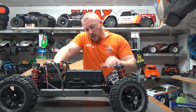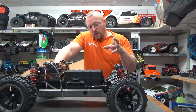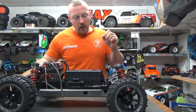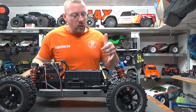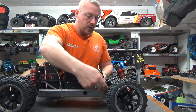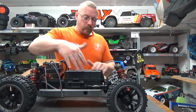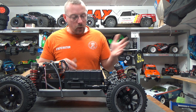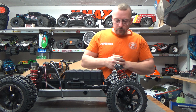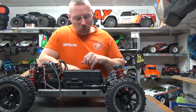The Ackerman plate is a plastic part, to not take too much heat. This stuff can be bent. And the other thing you must know, if you really think that the Ackerman plate made from plastic is strange, is that you have 2 servos. You have one left, one right, you have 2 servo savers, so the Ackerman plate is not really useful. It's just to put everything together. But you can take this Ackerman plate away and drive with 1 servo left and right without any problem. That's why you don't need a fat alloy plate for the Ackerman plate.